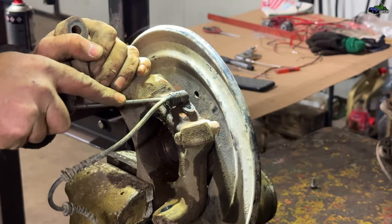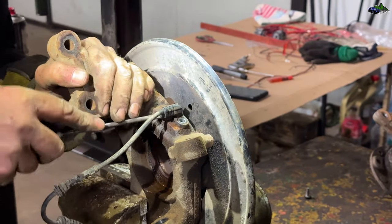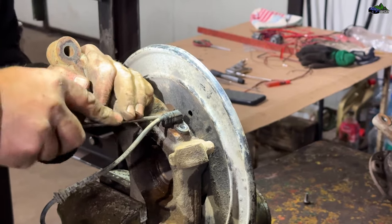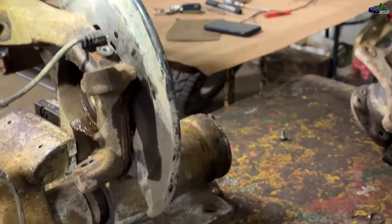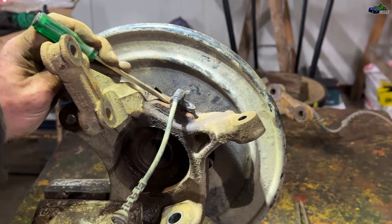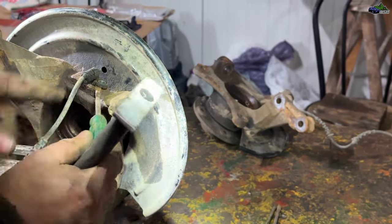Turns out that this simple wheel bearing replacement is quite an adventure, because we had some problems with a part which was definitely not expected. In my case, it seems that the ABS sensor is stuck in its place near the wheel bearing. And you have to take it out in order to remove the old wheel bearing and replace it with the new one. In our case, we lost about an hour trying to remove the ABS sensor without breaking it.